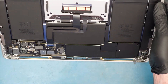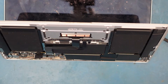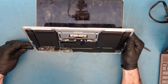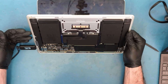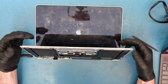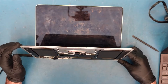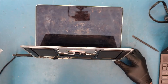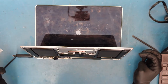Let's see if at least the power is on. Let's grab my USB-C with my voltmeter. Make sure it's testing out and okay. That screen looks nasty — I'll have to clean that after, it looks really gross. Let's plug it in. Now we're getting 20 volts here, and you heard the chime come up. We have power again now. We also have a working power button — let me press it. I'll wait for it to load, shut it off, and turn it on with the power button. Boom — it did turn on again. Everything looks pretty good. That was the main short that was going on.